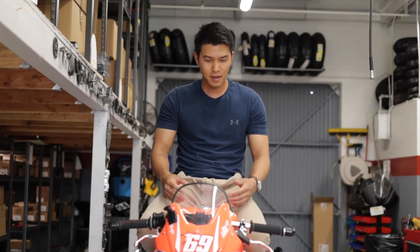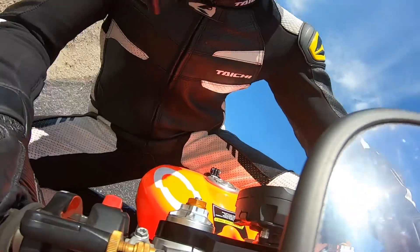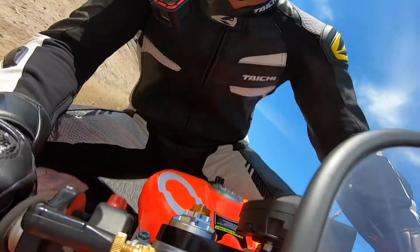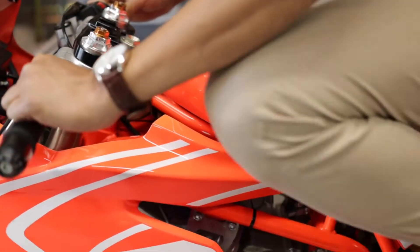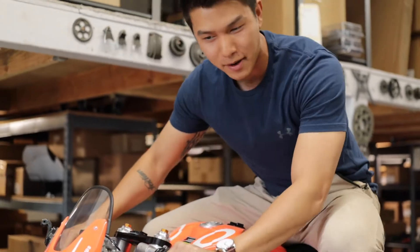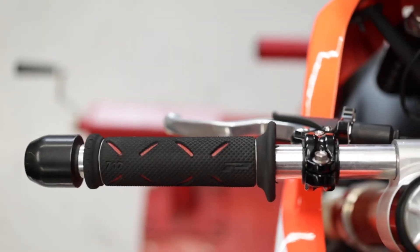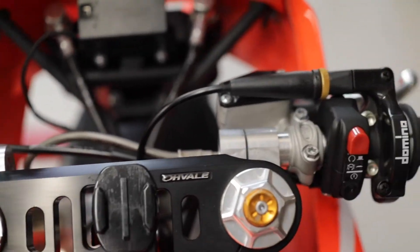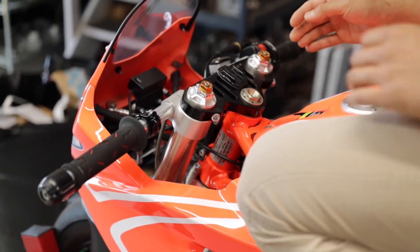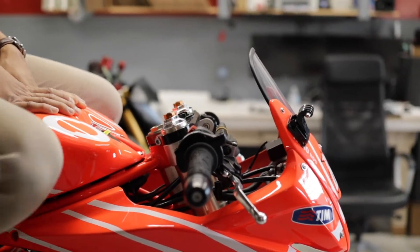There are a couple of modifications I had to make to feel more comfortable on the bike. The first one being the clip-on position, or the handlebar. The stock position is angled, and when I tried riding with the clip-on at that angled position, my knee was hitting my arm or my elbow — especially with the suit on, which adds a few inches to the kneecap. Anytime I was in a tuck position and had to swing my leg out, it would get caught on my elbows. So I had to swing the clip-on out almost perpendicular to the bike, which added an incredible amount of leverage to an already sensitive motorcycle and now it feels very twitchy going into corners or changing directions. But that's a compromise I had to make to be able to freely move around on the bike.